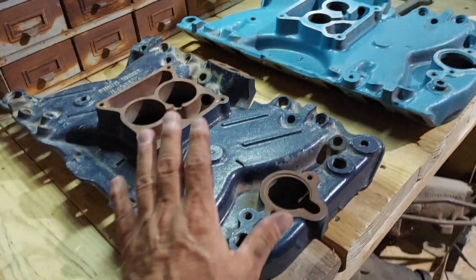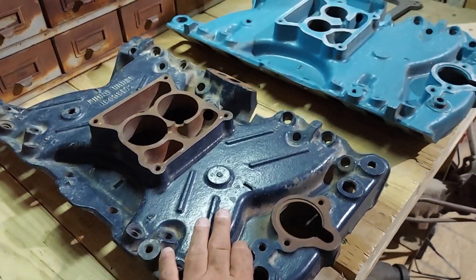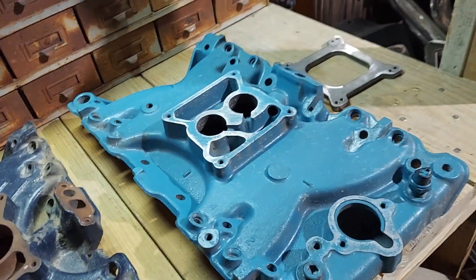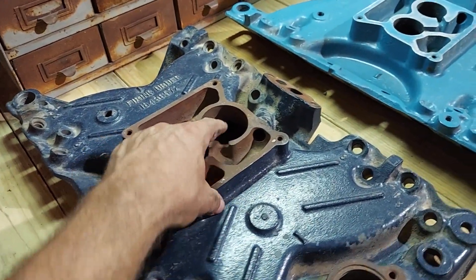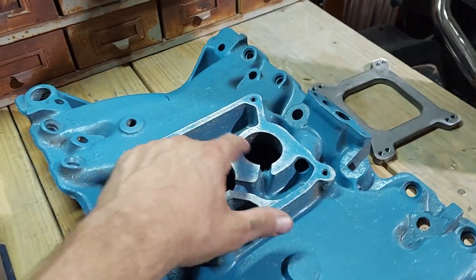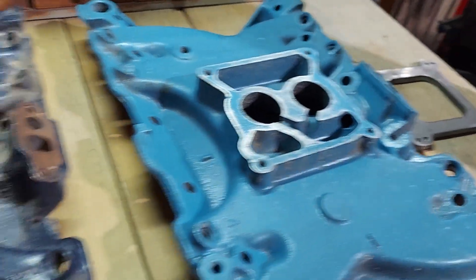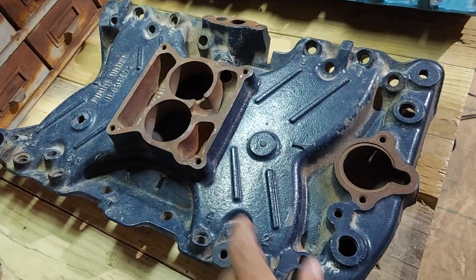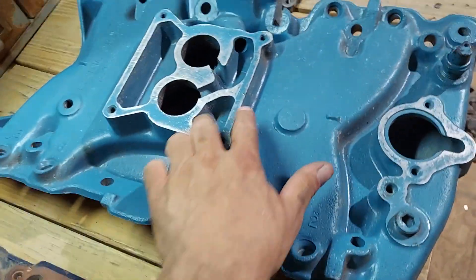The one on the left is iron and it was used on the earlier Cadillacs — the Cadillac Seville — and then later they switched over to this aluminum intake manifold, which was also used on the Cadillac Eldorados. The early manifold has a larger throttle body bore, and later they switched to a smaller throttle body, probably realizing they didn't need such a large throttle body on just a regular 350 engine. Another way to identify the iron manifold is that it'll have external ribs, whereas the aluminum intake won't have those ribs.